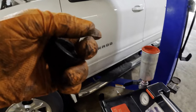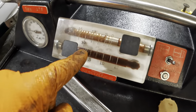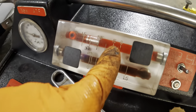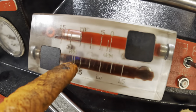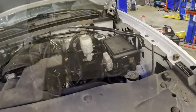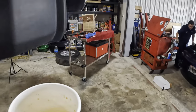While we're over here, let me check on another vehicle. We're doing a transmission fluid exchange on this unit — we have dark used fluid being displaced by brand-new fluid. It's a 2016 Silverado with 40,000 miles on the trans. We have to let the machine hang out on the truck and idle for a little while while the cleaner runs through the transmission.